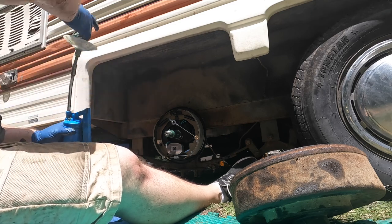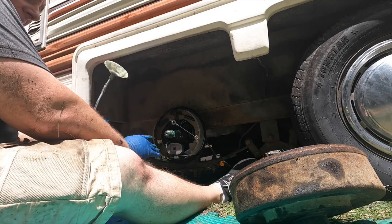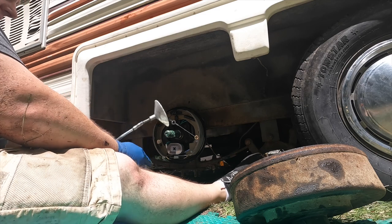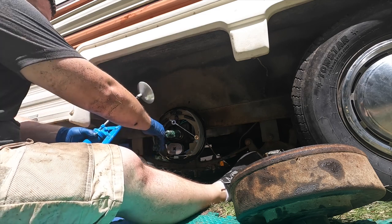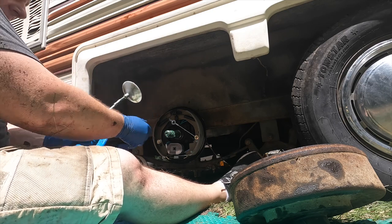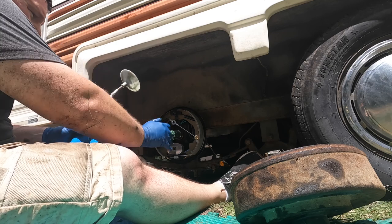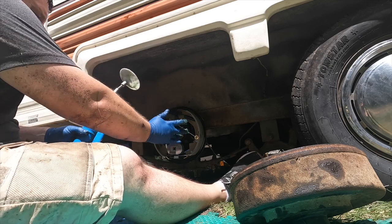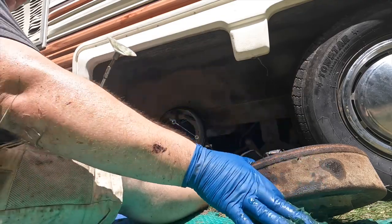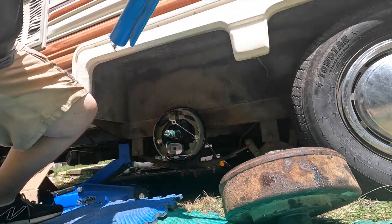The other reason I got a grease gun: my camper is an '83 and I saw this hole in the middle. A lot of newer ones you can hook your grease gun up to that, it squirts down through the spindle — there's a hole in there — so once you put everything together you're pumping it in and you can spin your wheel and fill the whole cavity with grease. Mine's an '83 and that's not a thing for me. So either way, you're going to put as much grease as you can on that spindle.